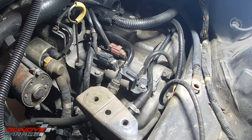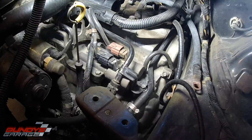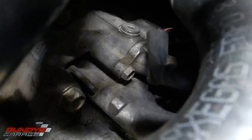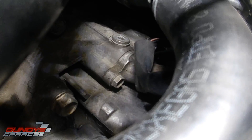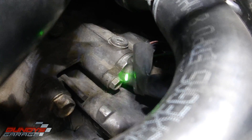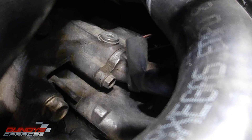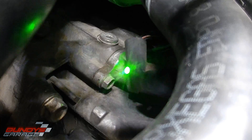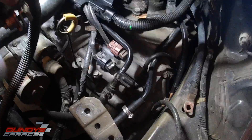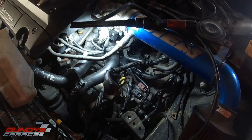If you get this P0740 code, Honda recommends replacing this solenoid. There's one right over here — it sits right below the thermostat. If you remember what 35mm film used to be stored in, two little black film canisters — I call that one the AB solenoid, and this one I call the linear solenoid. If you want to see where this is sitting, it's right below the battery. I actually removed the battery so I could get a better shot of this for you guys.